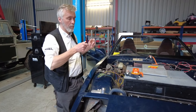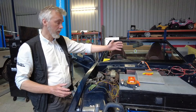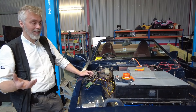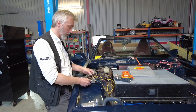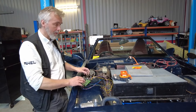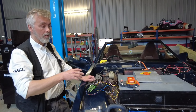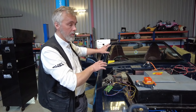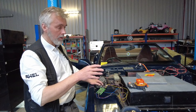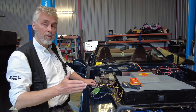Then we've got the vehicle controller, which does all the safety-critical stuff and works out whether the thing's overheating or not. It does all the contactor weld checks and correlates all the data from all the different CAN bus systems — from your gas sensors and isolation sensors together. For the safety-critical stuff, we're using the same software development standards we use for the commercial bus conversions. It's a bit of an expensive process, but it means you've got a very robust piece of software doing all the safety monitoring.